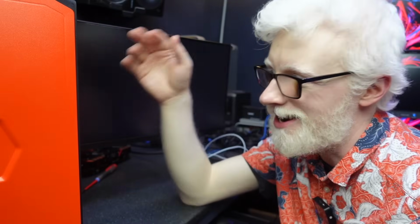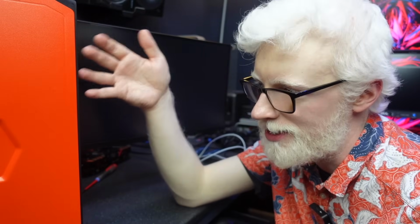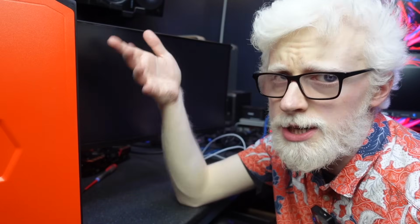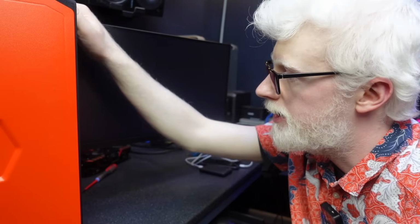I've got two systems here with crossfire configurations, but it's kind of like stick both cards in there, tick the box, job done. In terms of actually dismantling them, I don't know how they behave when you just yank one card out willy-nilly. This definitely looks like it's a video card problem though, or something video related, because it loads up, starts to load Windows, says welcome, then goes completely and utterly black. And the system is dead. The system is completely dead.